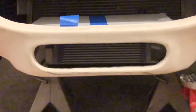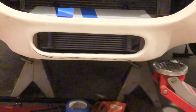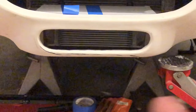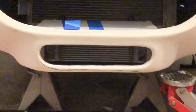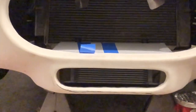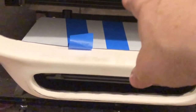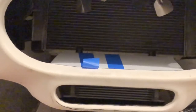Alright, we're mocked up — just a little fiddly, getting the angles right. Hard to see, but drilled a couple of holes there in the bottom. I'm going to use this piece of steel, cut it to shape, and use it as reinforcement — have a nice little skid plate there. The bolts will go through that. Really unnecessary to hold the oil cooler in place, but it will hold that nice chunk of steel that I can paint. You'll never see it, but it's pretty low — you're gonna hit speed bumps and driveways, so why not protect your finish. I'll get on that tomorrow. I'm still going to fabricate a piece of aluminum that goes from the oil cooler shroud to the radiator — it will reinforce, hold the top in place, and also cut off airflow from going by the radiator.